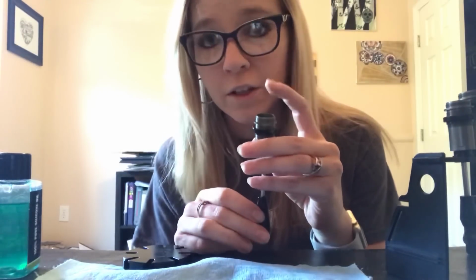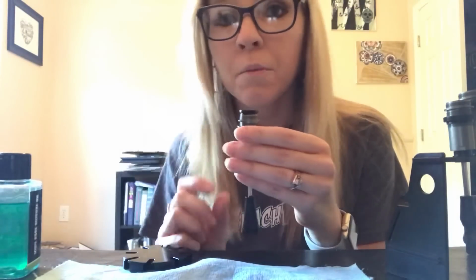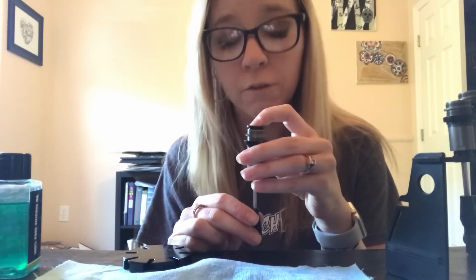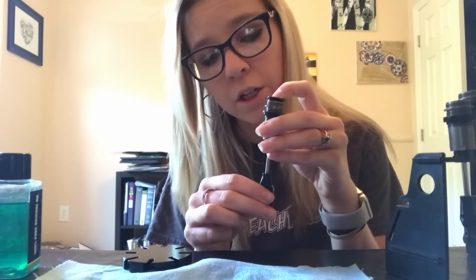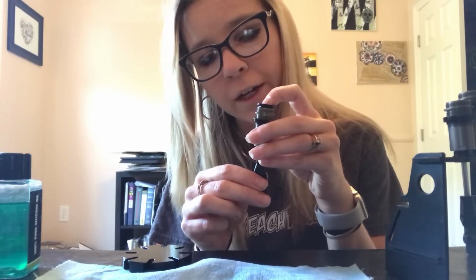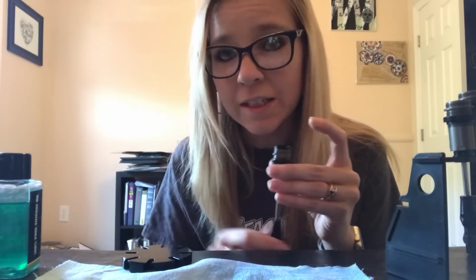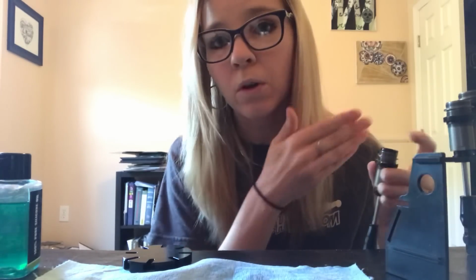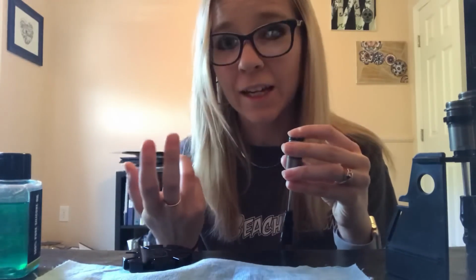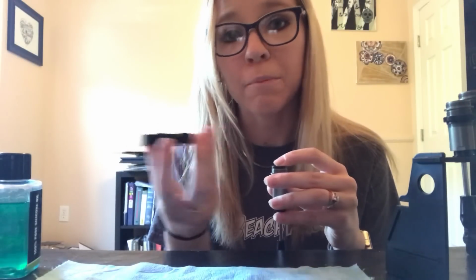So prior to having this tool, you want to go ahead and put the bladder on. Prior to having this tool, how I would set my rebound is, it's best practice for hot bodies to push the shock shaft up, and when you feel the piston touch the bladder, that's kind of where you would set it. Not very consistent, because when I build all 4 of my shocks, I'm just going by feel and not really by a setting.